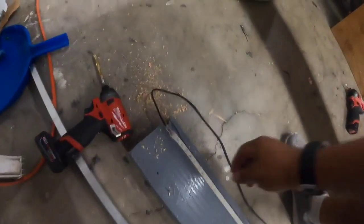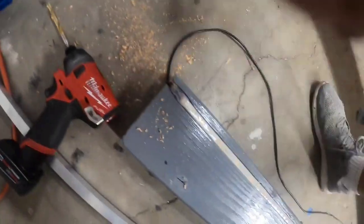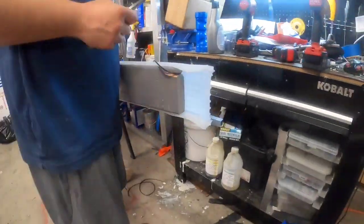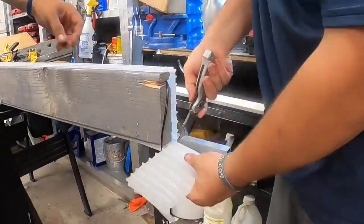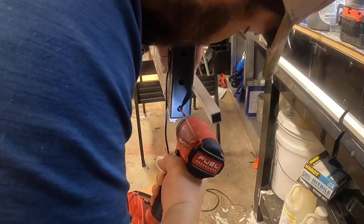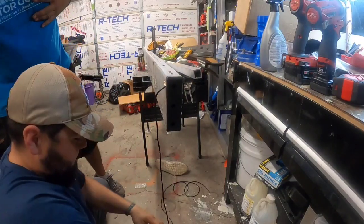We noticed that at the end cap, you're going to have to route a little hole to run the wire and hide it under the end cap. It's going to come out at the bottom, completely away from the boat, so when the boat hits the bunk it can't catch the wire. There was no routed hole through the end cap, so we made one through the wood. You can also just drill a hole through the very top of the end cap — it has a higher groove just past what the wood stud covers, and you can run a wire through it safely. You also have to watch where you route that wire: if you route it an inch from the back as instructed, that one screw will actually go right through the wire. So we didn't put a screw there — just FYI, don't do that. There are ways around it.